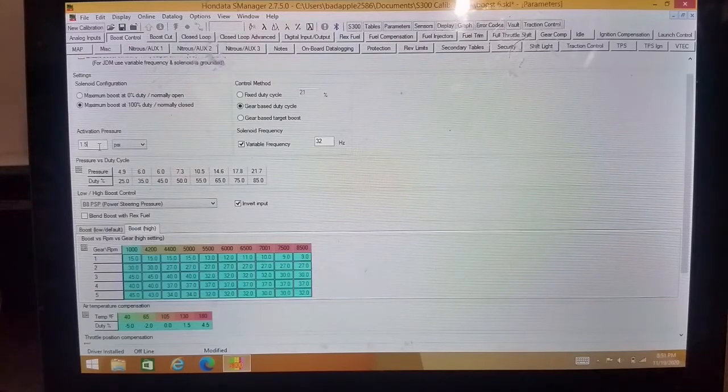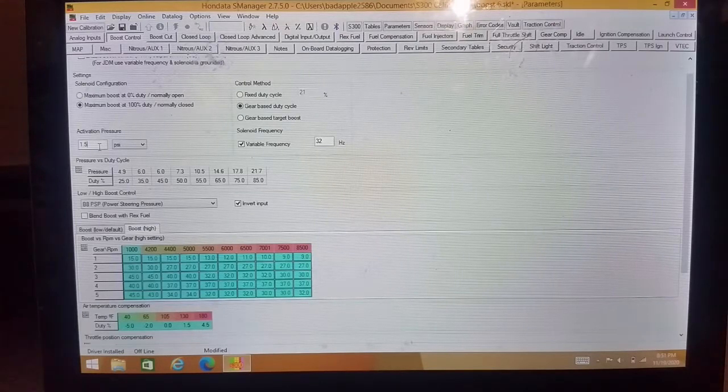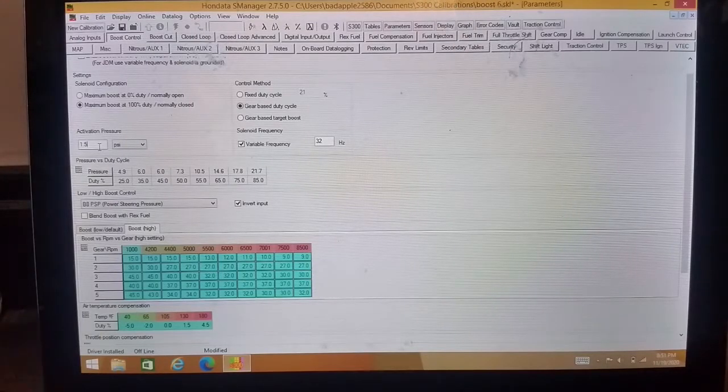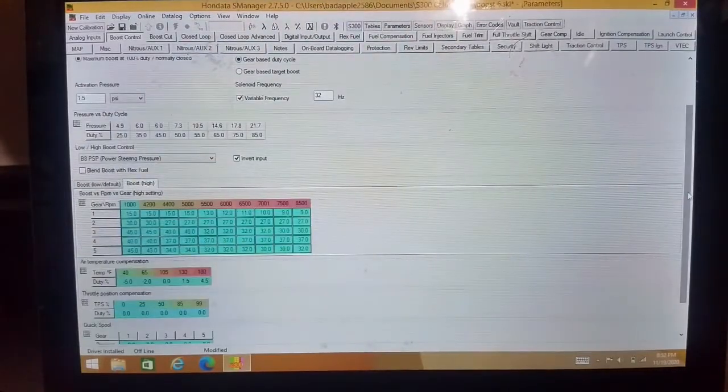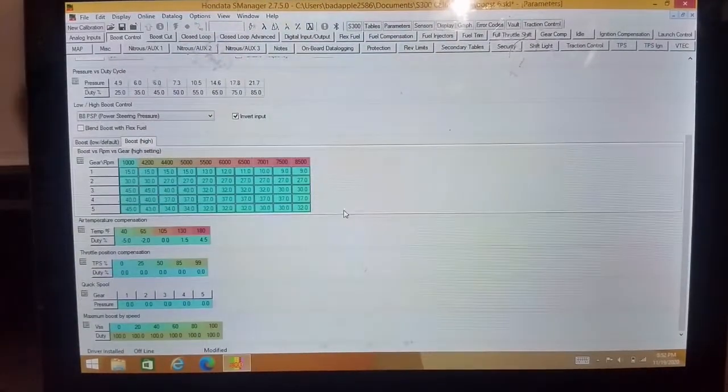So if you were to have it, say, -2 psi or whatever, then that sucker is going to come on and off and on and off, and you're going to have to replace it more than what you would like. So just for reliability issues, I keep it up a couple psi, especially if you have a medium heavy foot. That saves you. It's just a smart idea. So then we'll come down here. You have the air temperature compensation.